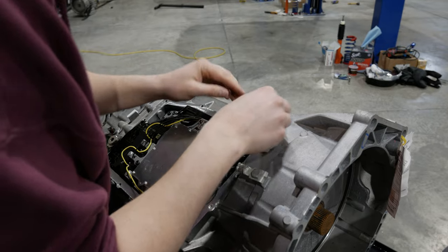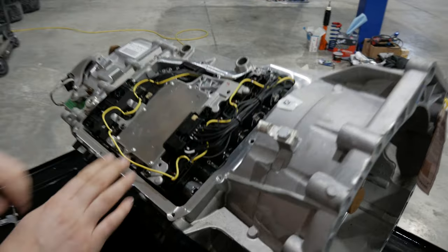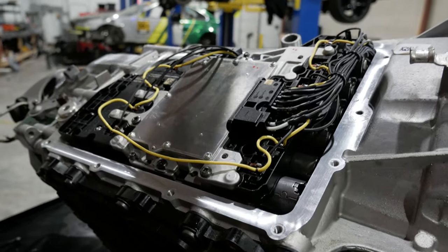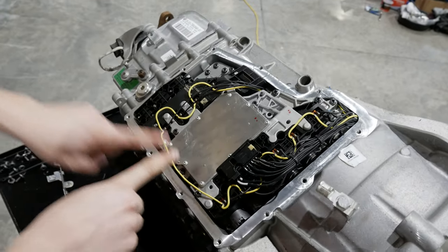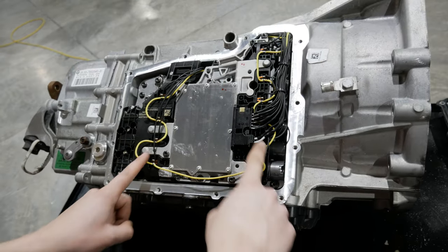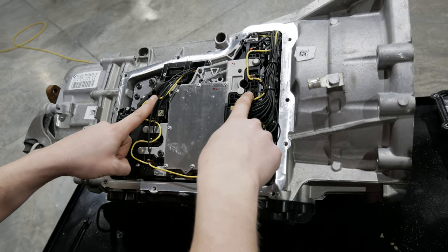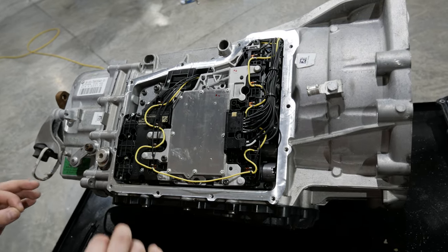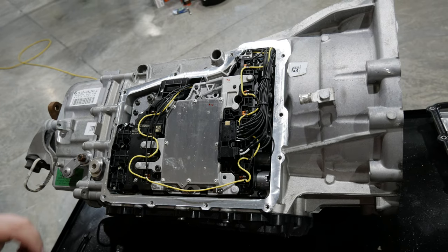We're looking pretty good. Everything looks pretty tucked away — nothing really looks like it's going to get pinched or anything. This is a crossover wire. The two power feeds come down, feed each solenoid, and then cross over and feed each other. What that does is give us a very good valve test, because if we just came down one side, these solenoids would actually kind of run out of power. So feeding from both ends gives us those really crisp valve tests, which lead to a very happy transmission. We like happy transmissions here.